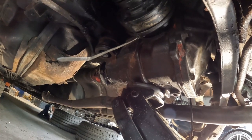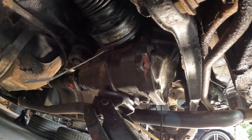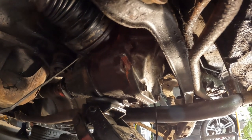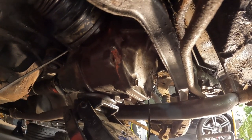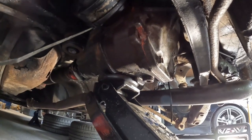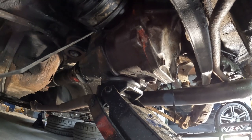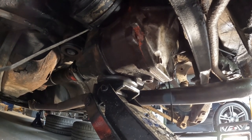As far as it goes, that's pretty much it. I put new oil in — the GT86 diff takes about 1.2 liters. I went with Redline oil. Nothing super exciting about it — just good oil. I'd also recommend changing the oil off the car: the drain plug and fill plug are 10mm and quite rusty, so soak them in WD-40, do it off the car, put your oil in, then put the diff in. It's 1.2 liters so it'll be a little bit heavier, but in the grand scheme of things it's nothing compared to the weight of the diff itself.